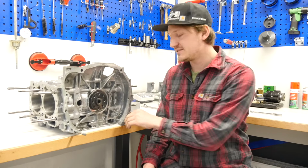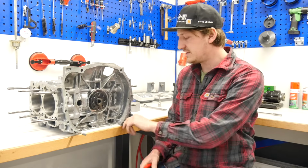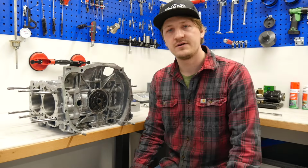Okay, the next super trick is the stud trick. You can use the stud trick anywhere on every stud, and I see a lot of mechanics who try to open the stud with pliers or something like this, but that doesn't work very well and mostly it destroys the stud. So we only need 2 nuts and 2 wrenches. There is nothing in the world as easy as this. You can do it anywhere. Put the first nut on the stud, then the second, then tighten it down like this, and now you can screw this stud out pretty easily and you destroy nothing. So you have no problems and you can use the stud again.